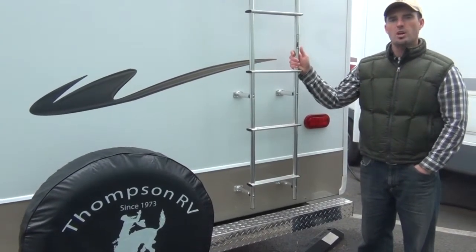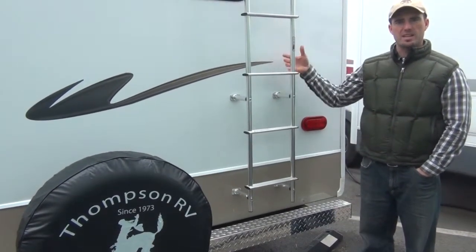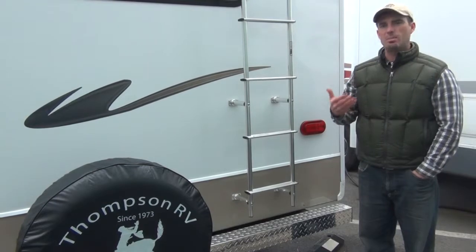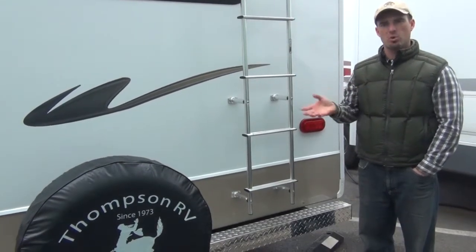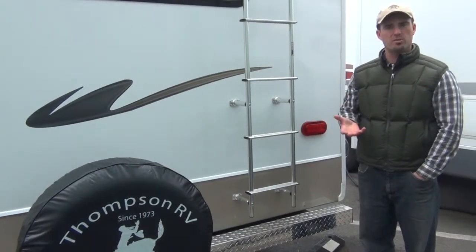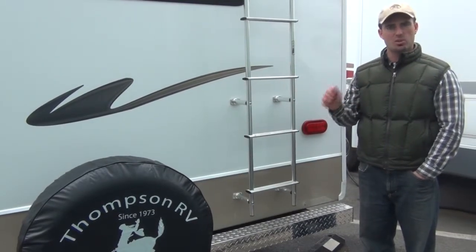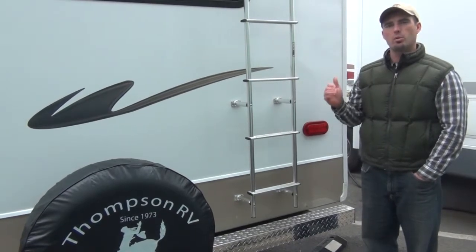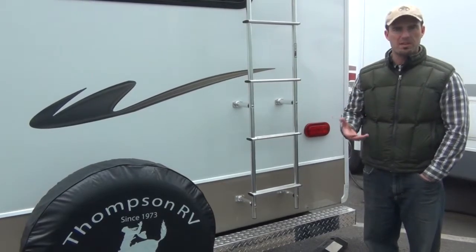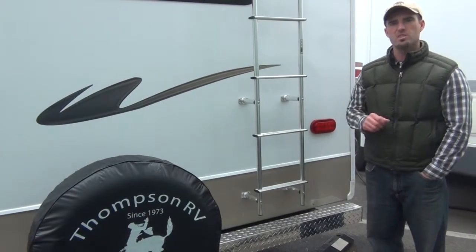You need to confirm that your RV has a walk-on roof before doing so. Most newer RVs are equipped with a rubber roof blanket. The biggest thing with RVs is keeping the water out of them. You really want to, at least twice a year, climb up there and check your roof sealant and make sure that all of your seams, moldings, and vents are looking very well sealed. If you notice anything that looks questionable, grab yourself a tube of DICOR rubber roof sealant and apply it right over the existing sealant over any spots that look questionable. Another good idea to keep your rubber roof soft and pliable is, every three years or so, use a rubber roof treatment or UV conditioner to protect it from the sun.